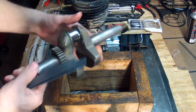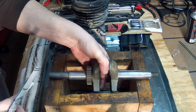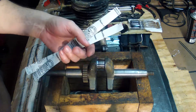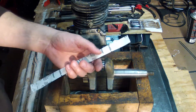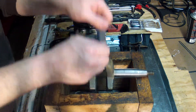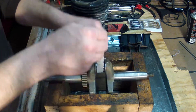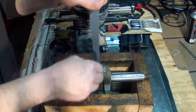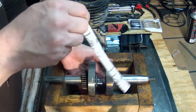This is the crank I just got — I've been taking aluminum off with the acid, got it dried up and cleaned up. Now I'm taking some fine sandpaper; I did not find any emery cloth at the store, so I picked up some 600-grit wet-dry sandpaper. Basically what I'm going to do is clean up the journal of the crank. It already looks pretty clean, but I'm going to get it nice and smooth before I put it back in the engine.